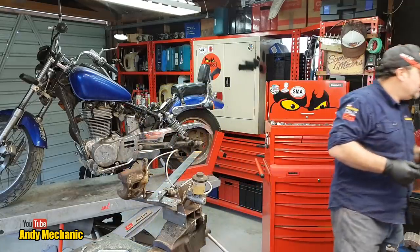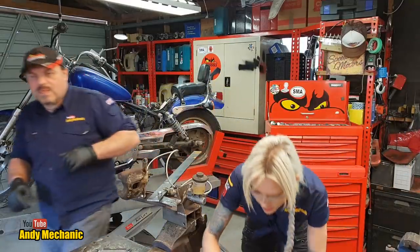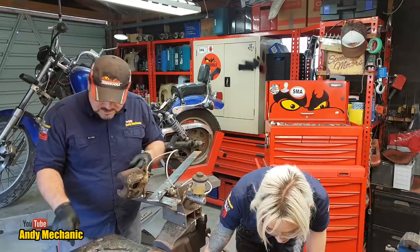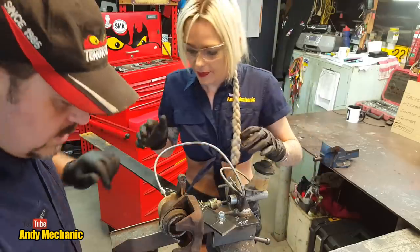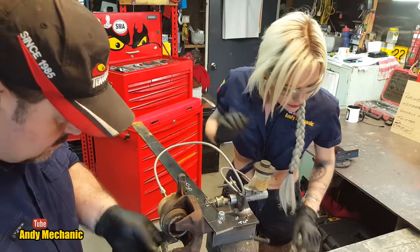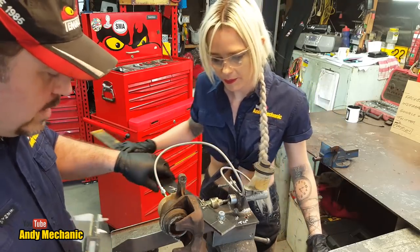A bit of scrap paper kicking around. That'll do. Bring it over here, Lily. Okay. 36.5. Yep, so we're at 36.5 at the moment, the gap with the piston. Right, if you now pull that all the way in, and I'll measure it again. Oh, hang on. Hold it in. We'll do it again. We'll start again. Okay, so let it come out. I'll take a measurement.